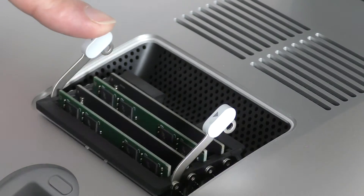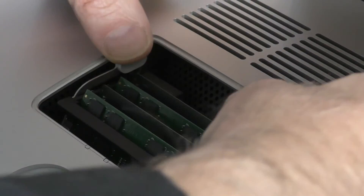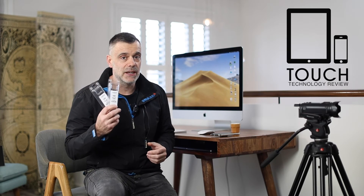When I had just a single 16 installed — so the two original 4s by Apple plus just one 16 — it worked fine but it was only running in single channel at less than 20 gigabits per second. So it still works when misconfigured that way, but as long as you're matching in pairs you'll get dual channel performance. If you don't match in pairs it should still work as long as the RAM is the right spec, but you might get reduced speed.